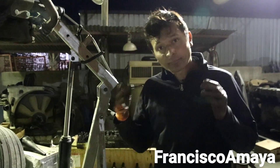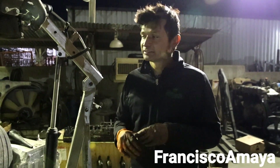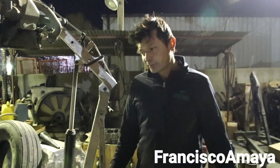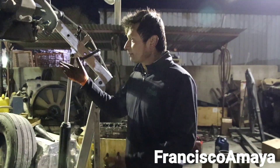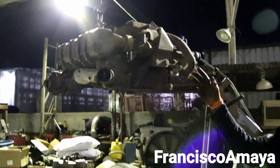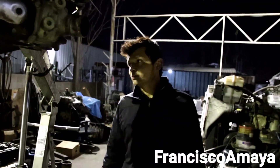This is why it's important: if your engine is leaking a lot of coolant and you need to fill it up with water, that's fine as long as you get to the closest destination. But if it's leaking so much that within five minutes it drains the whole coolant system, you will have to stop and tow the truck. If you keep driving like this, the cylinder head could get damaged — and that is a super expensive repair, because nobody will want this head as a core anymore. It goes to scrap and you have to buy a new head or rebuild it and pay the full core charge.